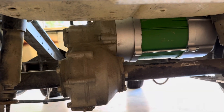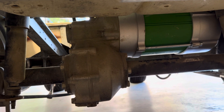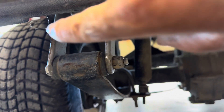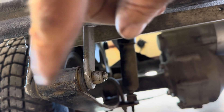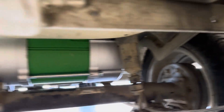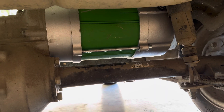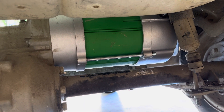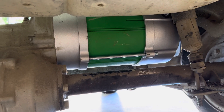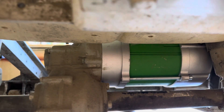I'd like to explain how I got that giant Navitas 5kW motor into my 1996 Club Car. I ended up taking the nut off right there, and up top there's a nut there too — pulled that out. This bolt is attached — it's crazy. Same thing on this side. Took those out, then took the shocks loose and jacked the center up. As you jack the center up, it pivots the rear end back towards you. I put the motor, which is very heavy, on a small floor jack, slid it right in, and it went right into place. I just can't imagine that's not the easiest way to do that — I didn't fight it at all. I hope that helps somebody out.